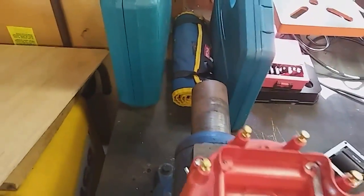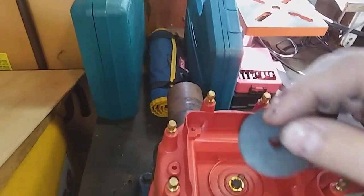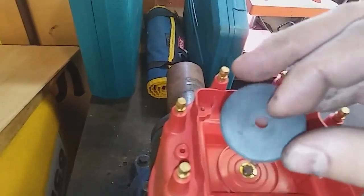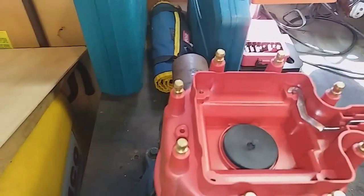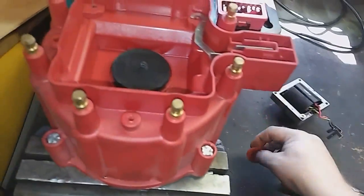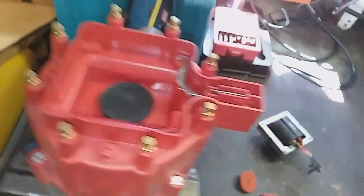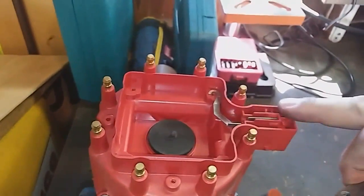I'm sweaty and a little irritated. This is just like a little pad to hold it down in place — this is one I just used the other day that came out of this distributor. Then you put your coil back in. The coil has a ground wire; those two other wires make sure they're up top, and the wires are facing out towards the thing to match this.